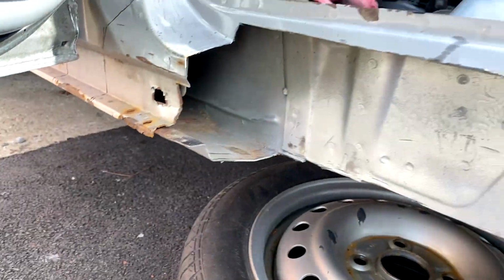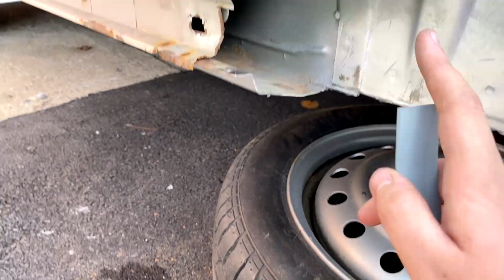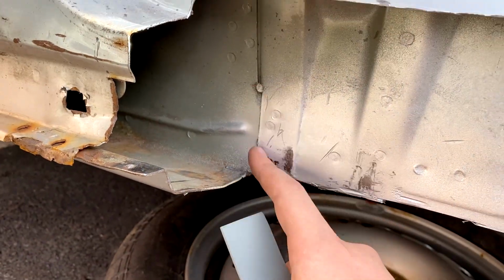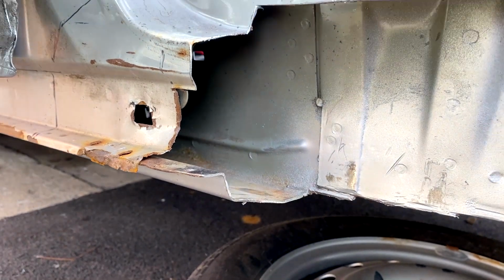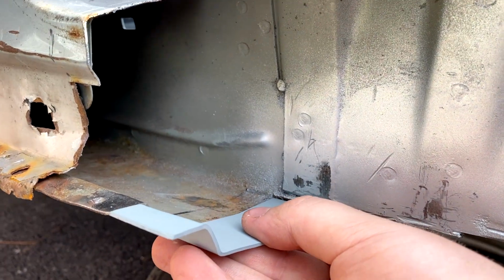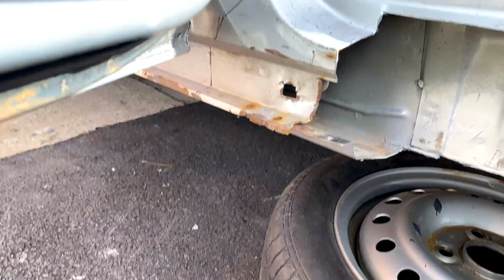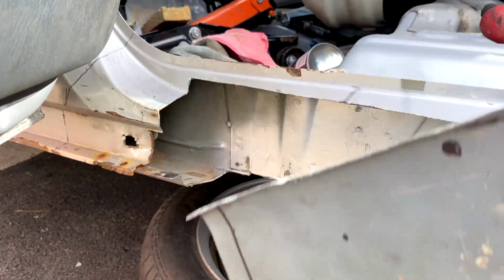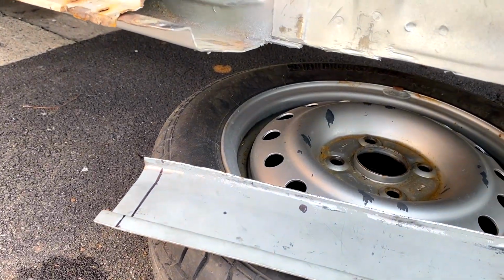So for this sill, I've also created this piece here. Where the sill overlaps, you've got your interlocking section here. And then the sill overlaps this sill here, as you can probably see where I've cut. So that's where this piece joins, and that's where the middle piece ends. So I've created a piece that will just slot in there like so, and that will allow me to get the sill that I've made and then lap it over